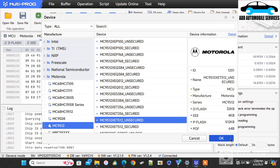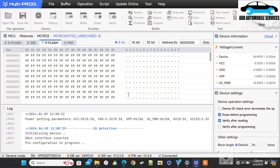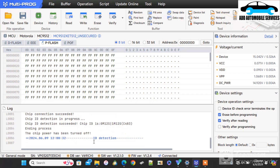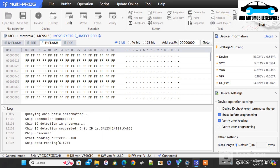This chip has 512 memory. I'll check my chip ID and see if I'm able to identify it with the same connection. I do a read to read the unsecure chip, and I've selected 'verify after read' to make sure I'm reading correctly. We tried it with the VVDI Prog and it wasn't able to read — maybe that was our fault. You don't need to read the D-flash or the E-flash.